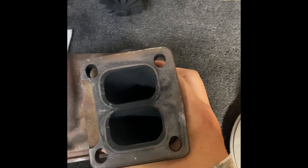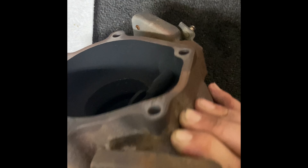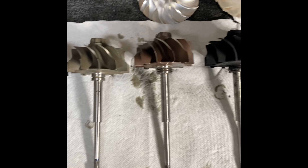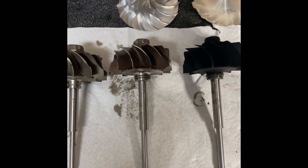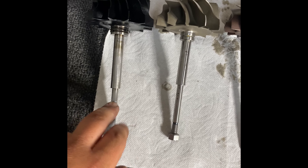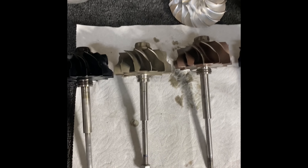There are a couple different flanges on the exhaust housings. Exhaust housing sizes are numerous. The most common is T4i. This one we have slotted to be T4. This one is a 16cm T4i gated — it did come with a 7286 turbine, a pretty special unit. That 16 is a fairly common size; the gated ones are not super common. The 84-70 that comes off the D12s comes with the 16cm, on the ones rated at 425 horsepower.